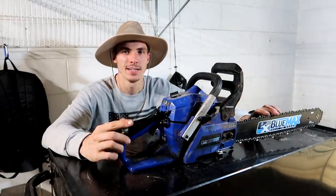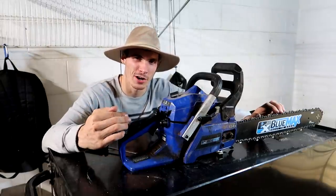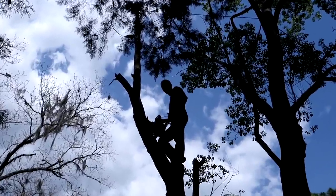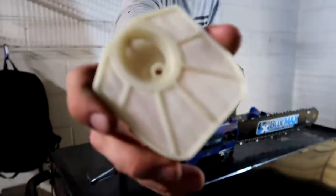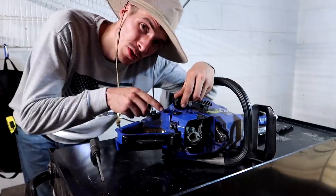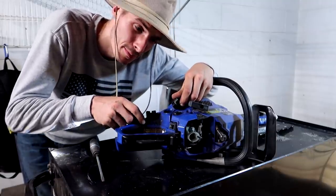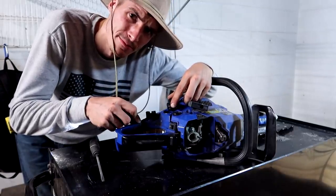Cole got up in the tree and started cutting it down with a saw that barely wanted to start and run. I have a little bit of debris in the gas tank, so I'm gonna go ahead and put new gas in, shake the saw up a little bit, then drain the new gas out — that way we flush the system.